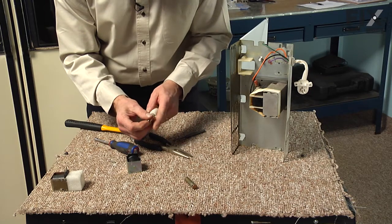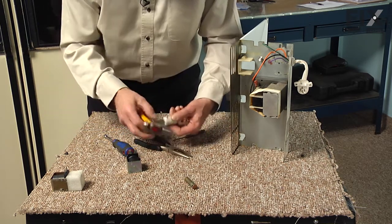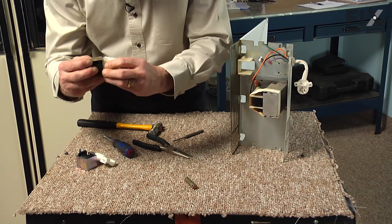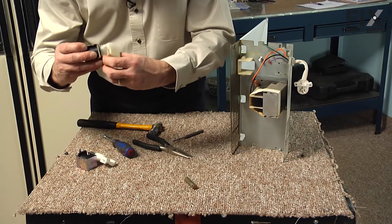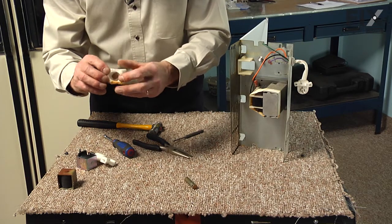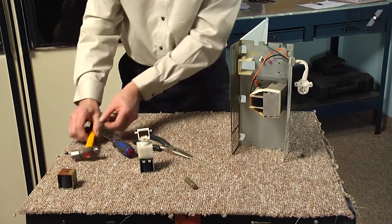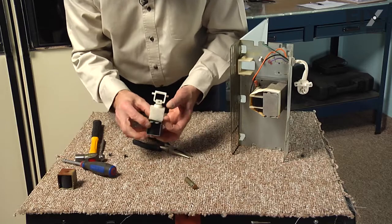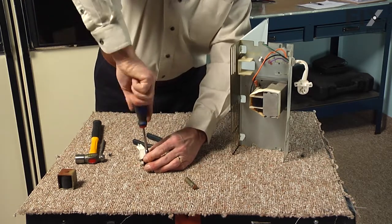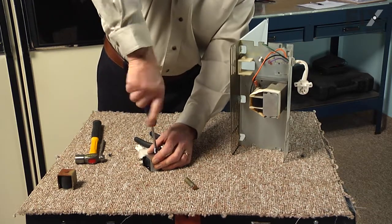Line the new one up. There is a spring tension on that, so we'll have to push that through far enough to line it up. Then just carefully tap that pin all the way until it's flush. Now there's also a foam cushion on that original solenoid — just peel that off, it has a self-adhesive to it. If the adhesive is damaged, just take some double-faced tape or apply a little glue to that. Then we'll attach it to the new solenoid. We'll set the plunger in place. Now before we install that, we'll want to make sure that the threads for the screws are cut into the new solenoid, so just run those screws in and out of that. That will make it easier to install it once we get it in place.